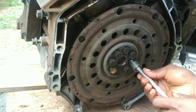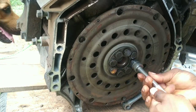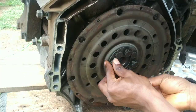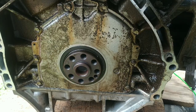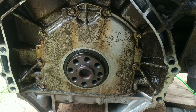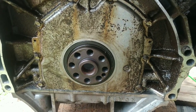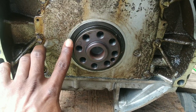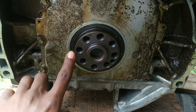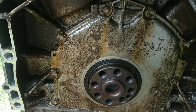With the 8 bolts holding the flex plate on, using a 17mm 12-point socket, I'm now taking them off completely as I'm showing. So with the flex plate off, we can see a lot of dirt and grease and oily mess and nastiness over here. That's the rear main seal — the seal that put us through all this work.